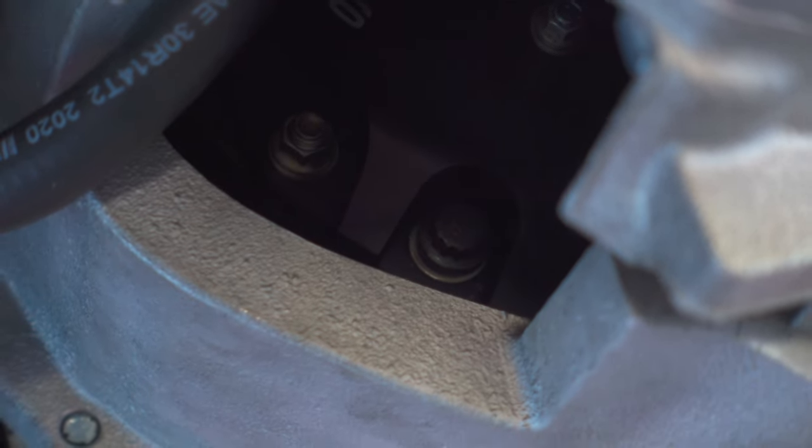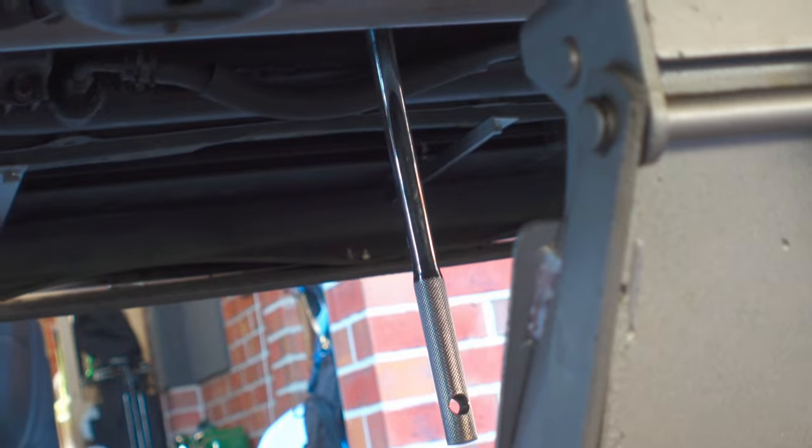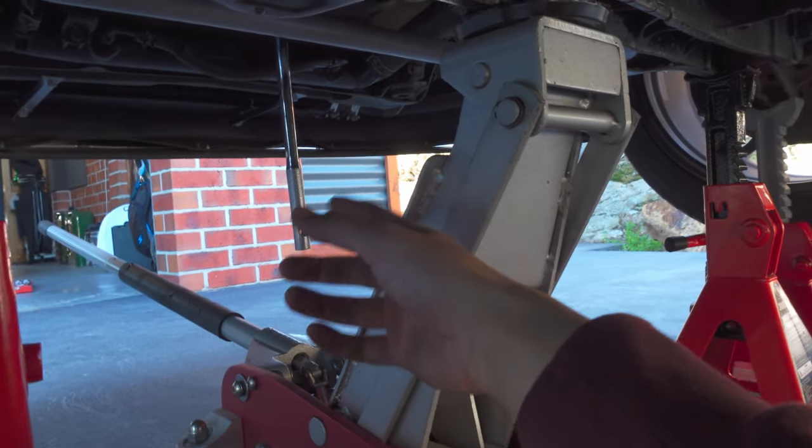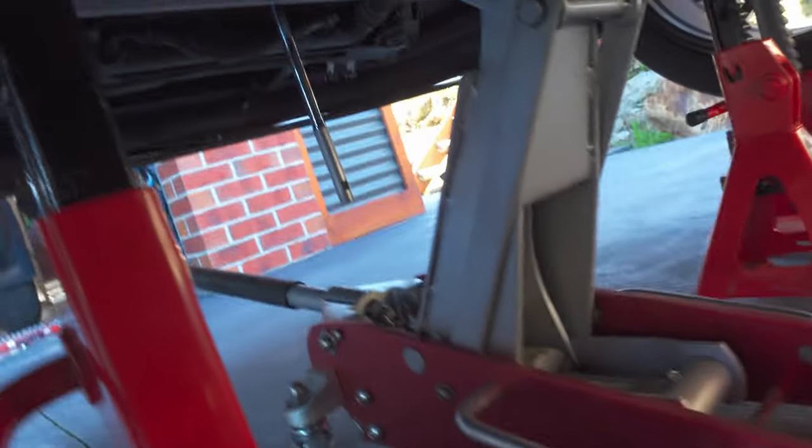Step one - I don't know if you'll be able to see those bolts in there, but I need to test if they are hand tight. I've got a breaker bar on the crank and I'm going to turn it slowly so that I can access all of those bolts and just see if they're at least hand tight. It's a bit annoying working by myself because I can't quite reach the clutch and also reach the breaker bar on the crank. Well, reached the end of troubleshooting with the gearbox still in the car - the pressure plate bolts are all at least hand tight, so I don't think they've backed out at all.